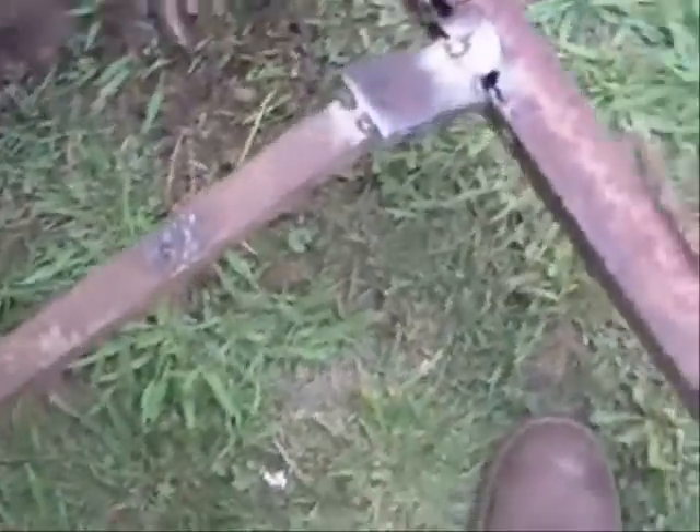This metal is so thin on this trailer that outside I just used the MIG, and you can see it just burnt through right there with nothing really there. I think I've got a pretty good hold here and over here. One test I know of is to stand on it. Oh yeah, she's going to hold.